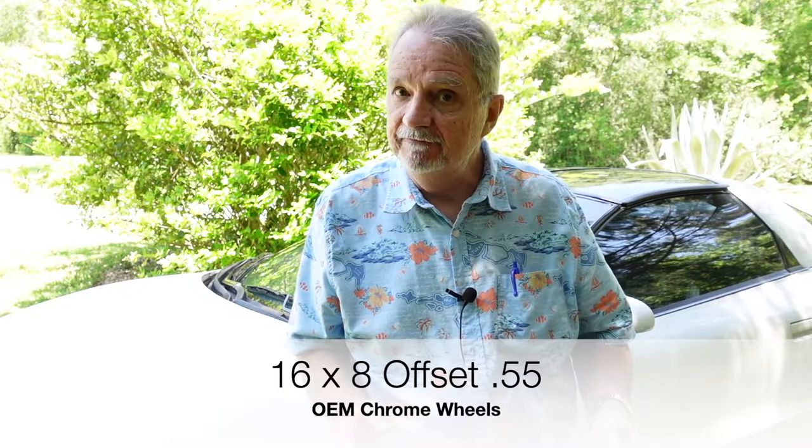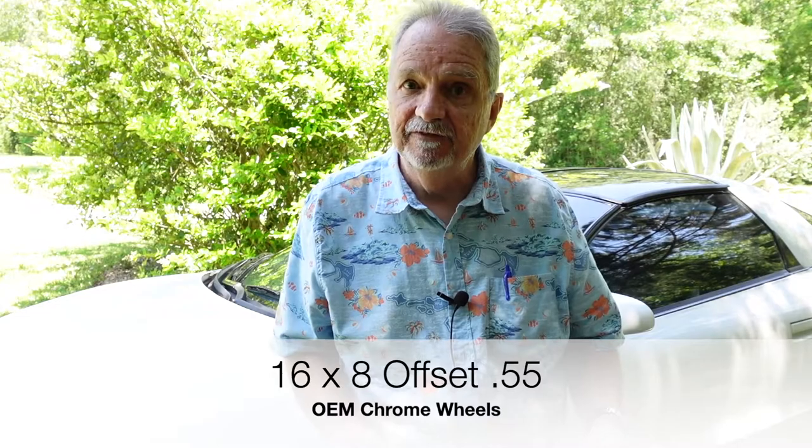Let's get into the numbers. Starting with OEM — what came on this vehicle: chrome-plated 16x8 rims with a 55 offset and a 120.65x5 bolt pattern. Finding the bolt pattern wasn't a problem. Finding the 16-inch wheel was impossible. Looking at 17-inch wheels, we had the issue with the offset. The offset they could find initially was 00, while the original wheels were 55. When those Torque Thrust 2s went on, the front was still scrubbing and the rear was exposed by another half-inch, sticking out beyond the fender.